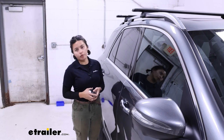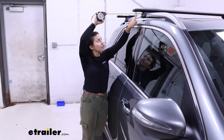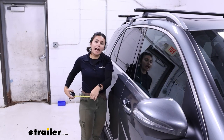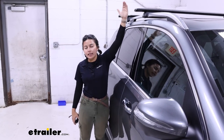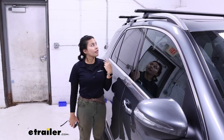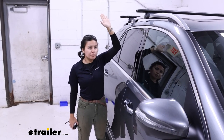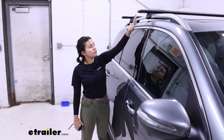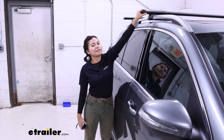The main thing with this one is overhang, and that's measured from the end of the crossbar or the end of the tower to right before the end cap of the crossbar. Here we have about three and a half inches of overhang. Some accessories require a specific overhang, like kayak carriers that have a load assist function like the Thule Hullivator. Some people don't like too much overhang because it sticks past the vehicle, and for smaller cars you could hit your head getting in. But with this SUV, it's not going to be an issue because of how high up it sits.